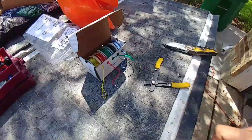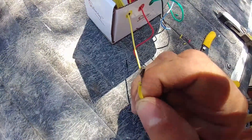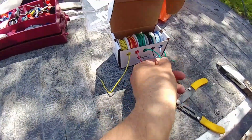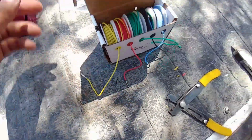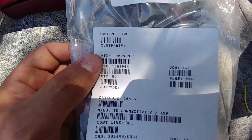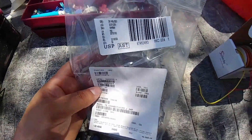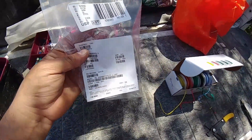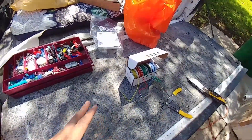I'm going to be crimping up the wires from my gauge cluster. These are the really small crimps. I already crimped two wires — you take off about a quarter inch, maybe less. The part number for these connectors is manufacturer part 928-999/1. Search by that part number. I got 50 of them from Newark online for $5 plus about $5 shipping.